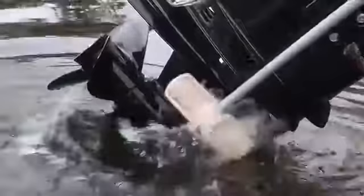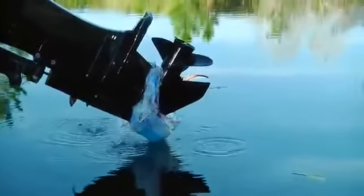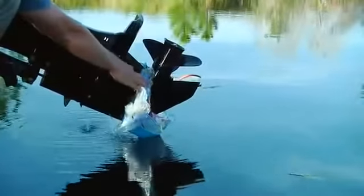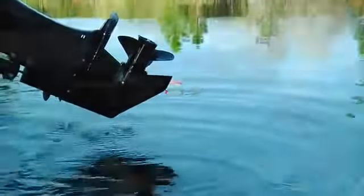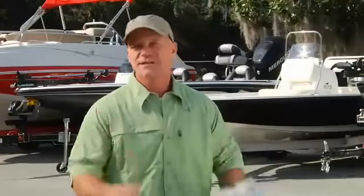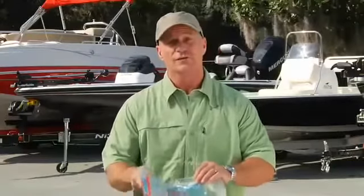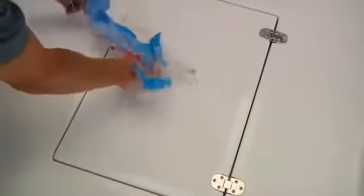This can occur any time you are out on the water. If you get a warning buzzer, high heat indication, or low water pressure at any time, stop the motor, trim up, and check the intakes. Carelessly discarded plastic bags can be a real menace. Besides being an environmental hazard, they can wrap around a lower unit and cut off water flow instantly. So keep a good eye out for these. Be sure you are not one of the careless ones — stow all plastic items where they cannot blow out.